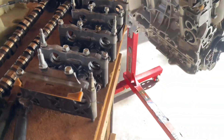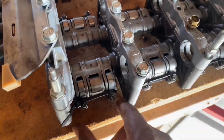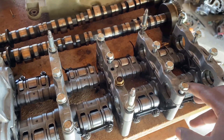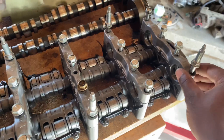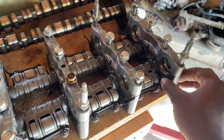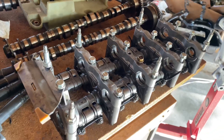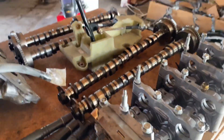Right now I want to talk about getting the roller rocker setup on. I always put zip ties on — it's a lot easier when you have the bolts in because the assembly can't separate. If you take the bolts out it comes apart from the housing, so keeping them in prevents separation. Now I'm going to go ahead and slap it on real quick.